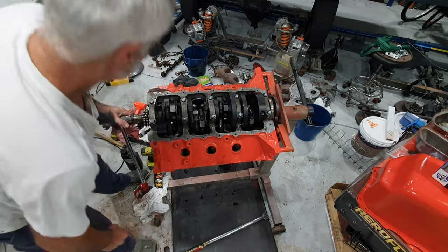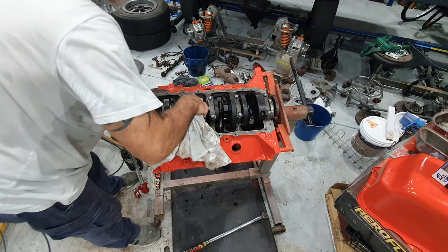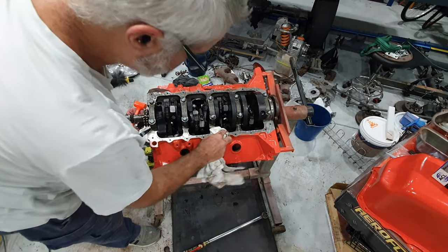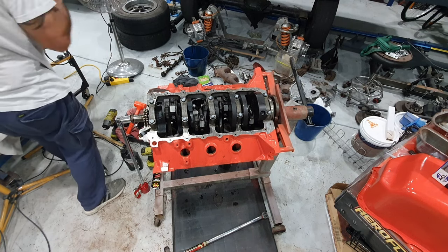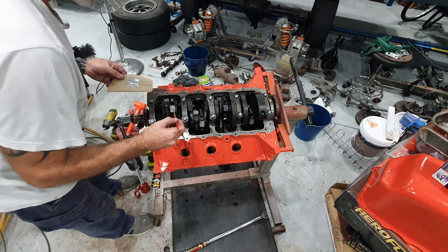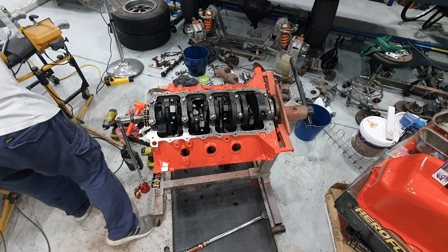There you go, that's all of the torquing process done in this bottom end now. It's time to get the oil pickup on and the sump on and roll this baby over. I'll just get that paint happening there so I can do it before I flip it over. Paint on there. Those ones are done. Get the next lot down, we'll turn it over again.